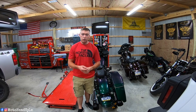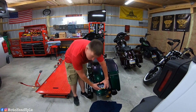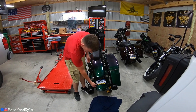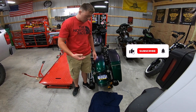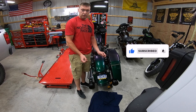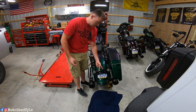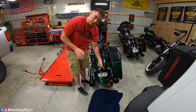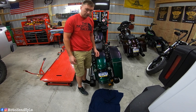Welcome back to the channel. In today's video we're going to be working on my 2021 Harley Road Glide Special — we're going to be installing the Harley-Davidson curved license plate. Pretty much all that does is curve the license plate; it replaces the plastic license plate housing and comes with a metal housing. To accomplish that we have to go up underneath the fender, take out two half-inch bolts, pull that off, then remove two torx screws — I believe they're T25s — and screw the new one on and bolt it back onto the fender.